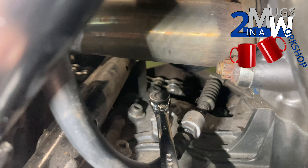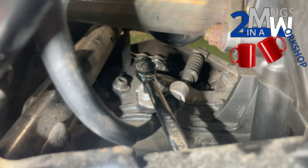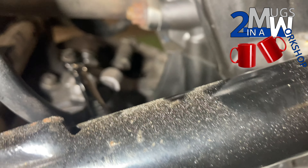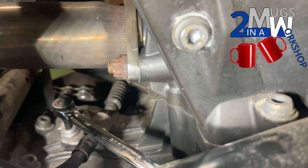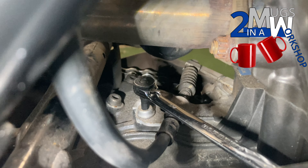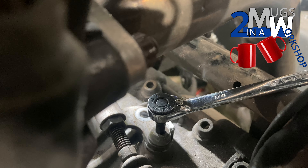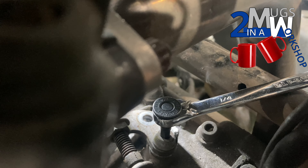You can see I managed to get a 5mm Allen key in this little ratchet. You've got enough access this way — the ratchet's coming across and you're basically pushing towards the cylinder head to let it go. Once it's undone, you can just take it out and unscrew those by hand. They're coming out really easy. They're not tight on my bike, so don't sweat too much about taking these out.